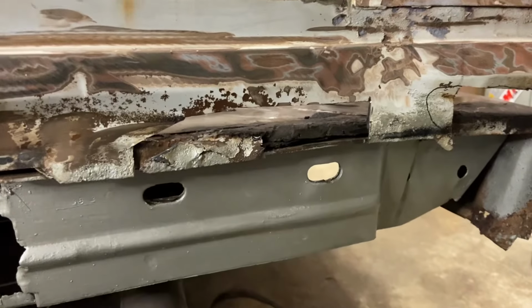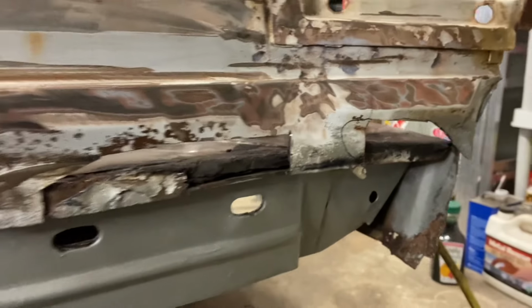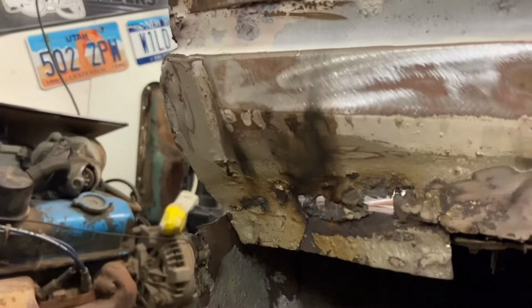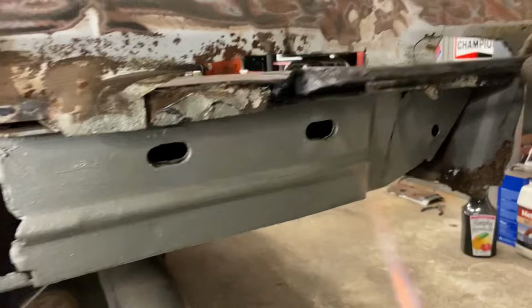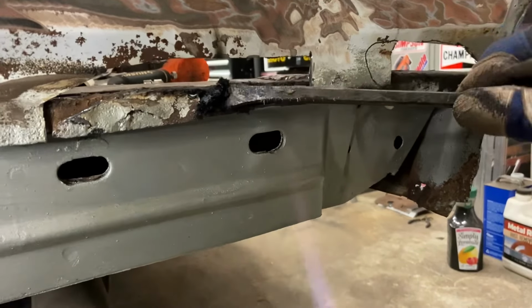And it's the same kind of process like we did with the gutters and everything else, just no bare metal to bare metal, making sure that we're replacing things, cutting things nicely, using butt welds, but that's what we're about to fix right there. And then we can do the same over here on this side. Get a little bit more of this goop out of here that we found, kind of hiding in this area, and we can continue moving forward.